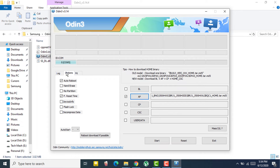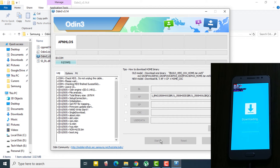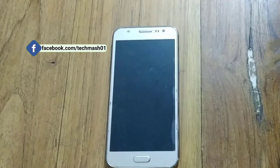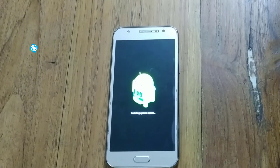Make sure you have selected the correct options, then click Start. You will see a progress bar both on your PC in Odin and on your mobile screen. When the process completes, Odin will say 'Pass.' After it says Pass, unplug your cable. Your mobile will then restart — just wait and give it some time. Do not turn off or do anything with your smartphone; just leave it.